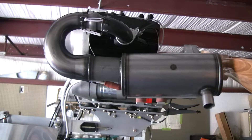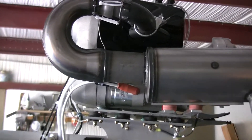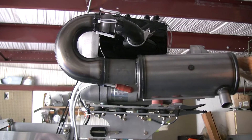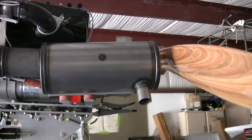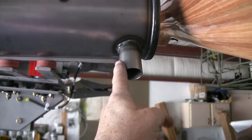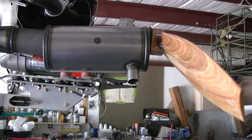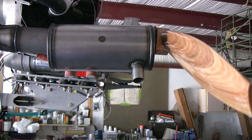The primary thing right now is you must install this muffler, and you want to make sure you get that mark set on that pipe and weld that thing so that it is at the proper distance in accordance with the factory manual. And though my pipe is pointed down at this angle, I might even consider putting it straight down. This is a pretty good angle — it is pointed downwards so that any rain overnight, if you parked outside, would not get down in there and rust your muffler out. And any condensation would be able to drain out.